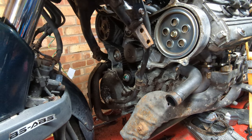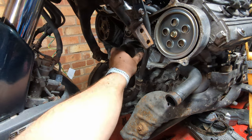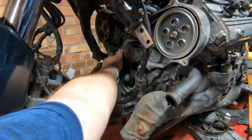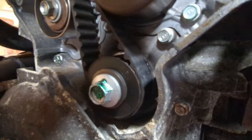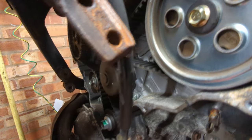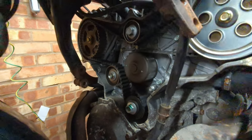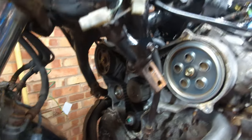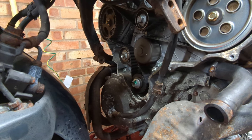Let's see what it looks like in here - so far so good. The cam belt's in slightly older, more worn condition than I thought it was from the inspection camera - a bit dusty, a bit crusty. It's good that we've got a new one, but we don't appear to have a water pump leak. We'll get the belt off and find out how the bearings are doing. I know I promised top end engine cooling stuff but I'm just far too invested now, so we'll carry on with this.